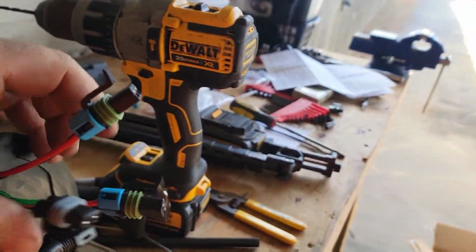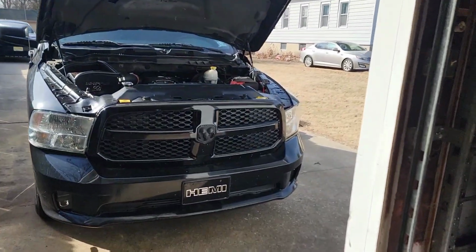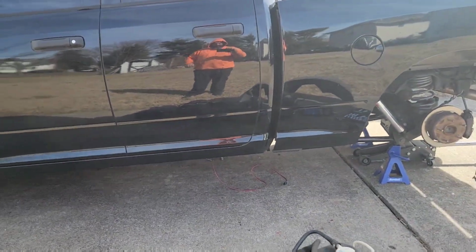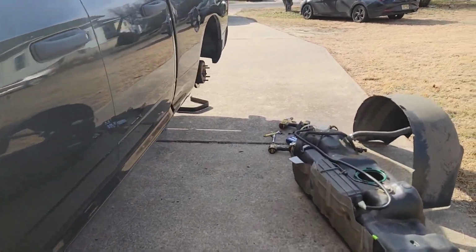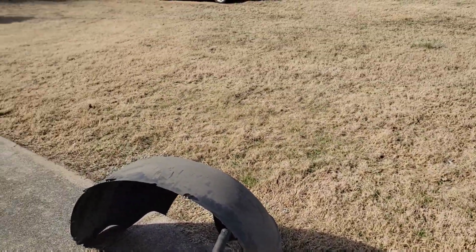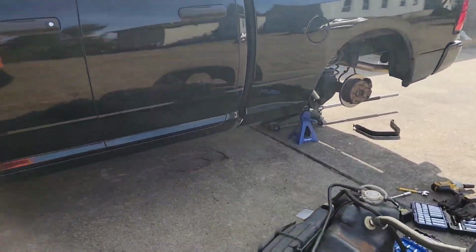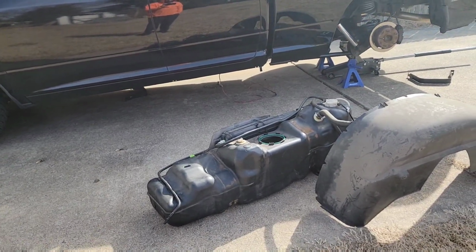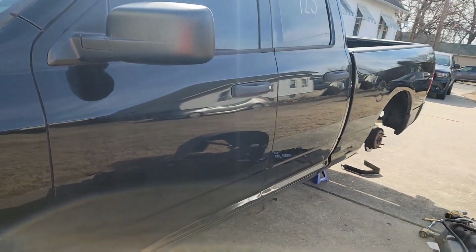All right, guys, here's an update of what's going on. Old basket's off, as you can see. Just finished wiring all the pumps. So this is for the fuel level sensor, pump 1, pump 2. I did run the new wires for the second pump. As you can see, that's the new wire. Once I pull through the truck and connect it, no biggie. But I got to do one more wire, and that's to the underside of the fuel level sensor. And then we can get the MMX back in here, button everything up, and see how things are going to go. So hopefully we can get finished up within a couple of hours, because putting back together is a pain in the ass. Good thing I had not that much gas in here, because I could lift it and carry it much easier. So like I said, we're going to get this wired up and then put everything back together and start her up and see how she goes.